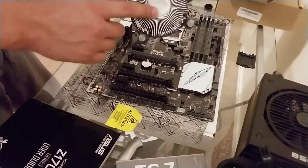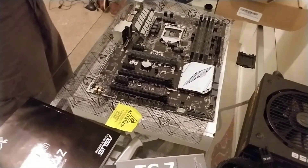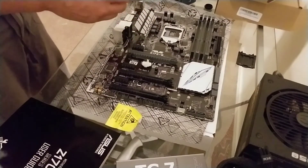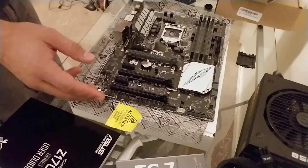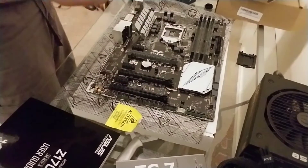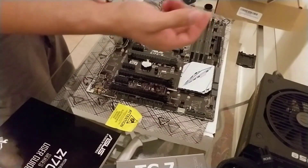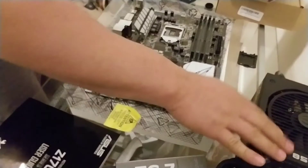You don't put the thermal spreader on the motherboard — you're going to be putting it on the CPU. Remember when you're dealing with a motherboard, watch out for static. If you're on carpet like I am, make sure to touch something hard and metal and big before touching your motherboard. I don't have an anti-static bracelet on, so I'm going to touch my power supply here.